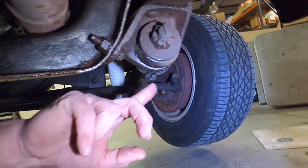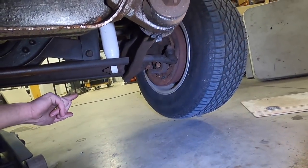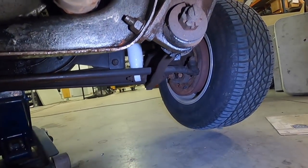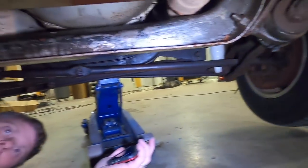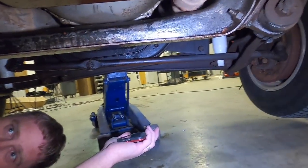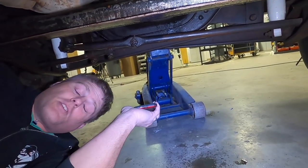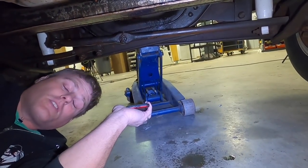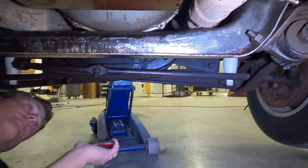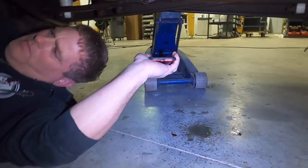One more thing: we've got a bad radius arm bushing. See this right here — that's a suspension bushing connecting the I-beam suspension to the frame to stabilize it. It's very common for these bushings to blow out. We'll just have to replace that — it's probably only 50 years old, got your money's worth. Also, shocks and springs are so old I can guarantee they're bad. The truck was lowered at some point in the '90s, so I'd rather just go ahead and replace them.